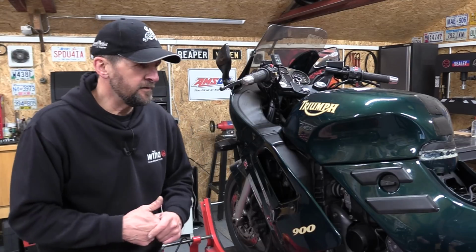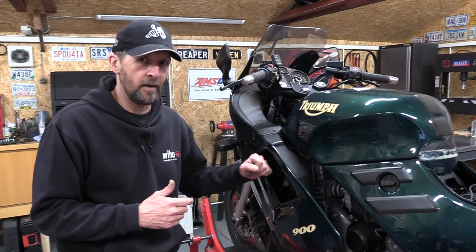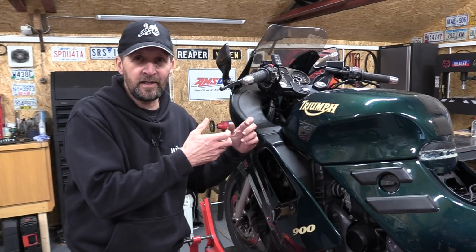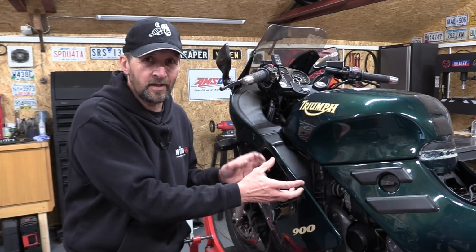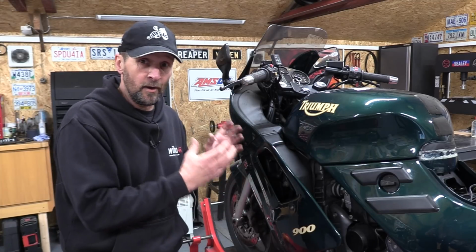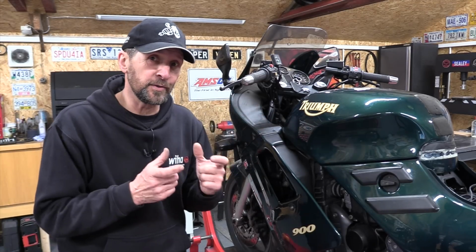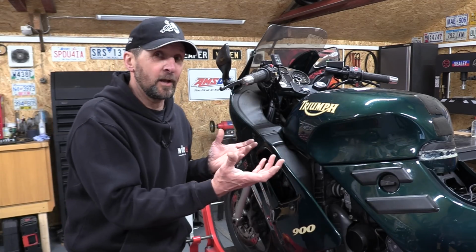Right, okay, now if you've ever done this yourself, you know there is a little bit of a challenge, and that's getting all the coolant in without an airlock. And the easiest way to do it is trickle it in really slowly. Give the coolant a chance to work its way into all the little coolers it lives in inside the motor and inside the radiator. And I managed to do that. I got 2 litres into the radiator, capped it off, and I got the final 200 ml into the expansion tank. And now the system is completely air-free.